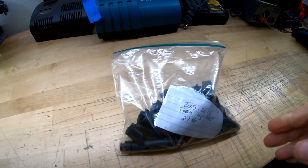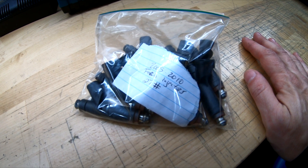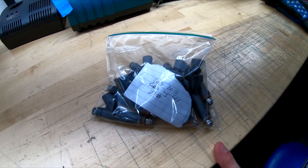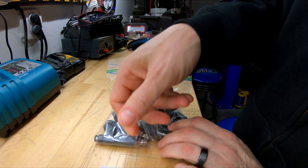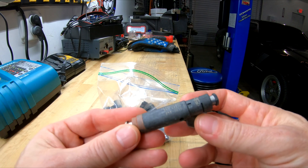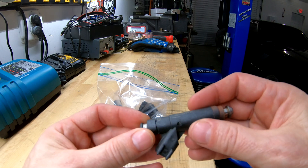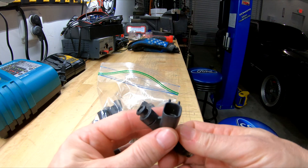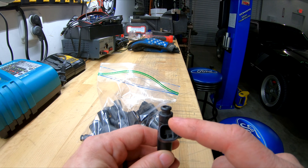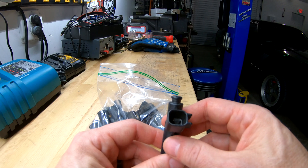These are a bag of three-valve injectors I've had for years. I had a 2006 Mustang GT three-valve, took out the stock injectors, and put bigger injectors in when I added a Kenne Bell supercharger. These are actually 27-pound injectors from the factory with less than 5,000 miles on them — basically brand new. I have new o-rings coming from Ford. You'll also notice they have an EV6 adapter, whereas the stock Ford connector is an EV1.